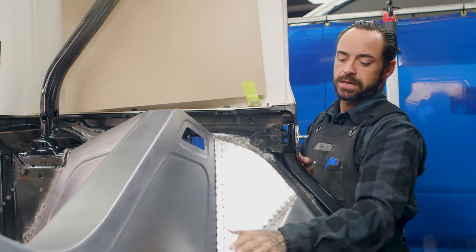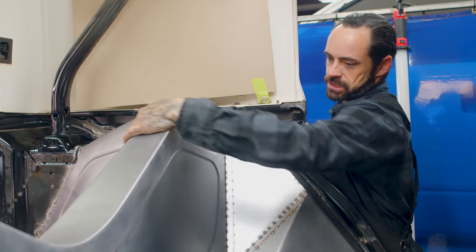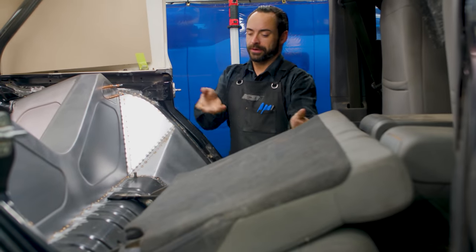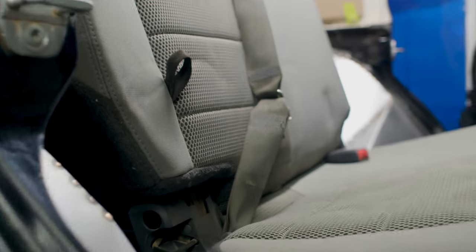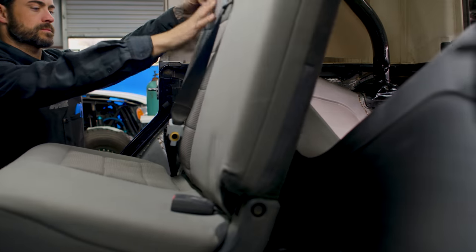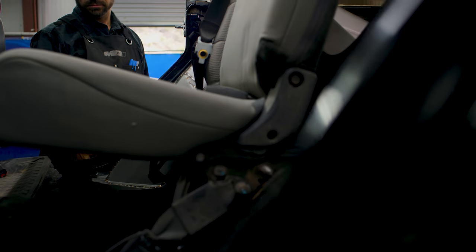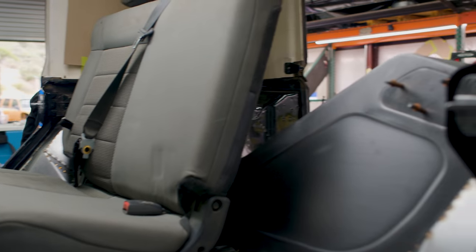With the design, the seat goes in and it's kind of a hard edge, and then we have it drop off into a radius — a smoother transition. We have the seat in here just as a reference. You can see this thing is tailored to go right there. Packaging is so important with sheet metal, because it's like you're skinning the skeletal system — you have every part and you're just adding the final skin in. It's got to be in the right places so you don't shoot yourself in the foot.